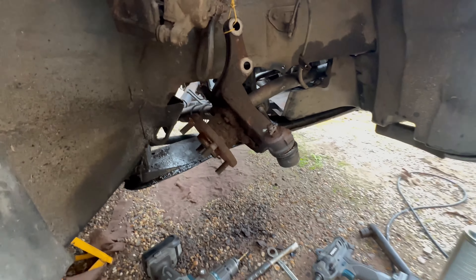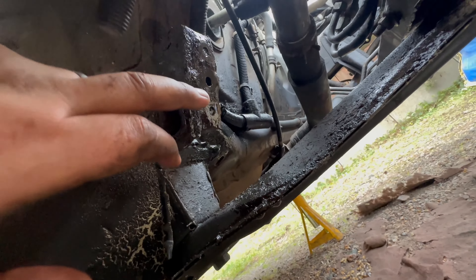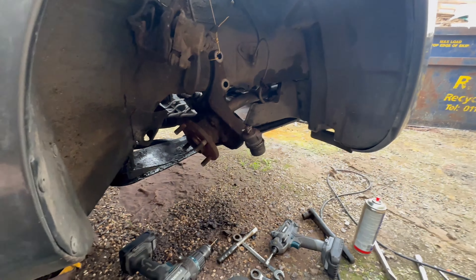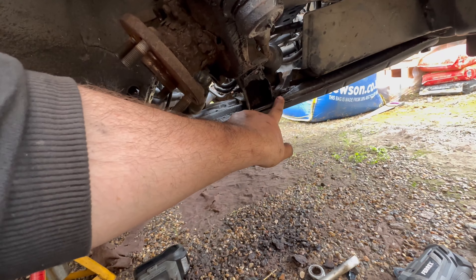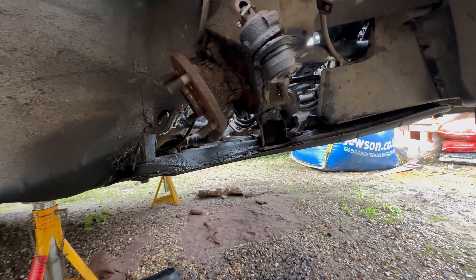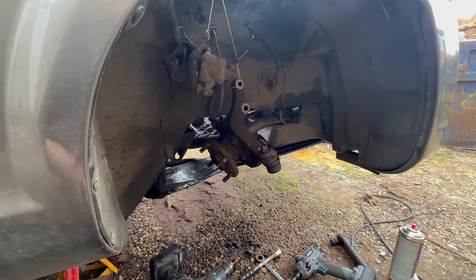I've removed the lower arm, which was not easy - I had to cut the lower ball joint and the rest is still in the back of the hub. I've got access to the mount now and I've started tapping a hole through it, but it's very tiring work. The new lower arms I've got match exactly the ones I've taken off, so I've got the right parts. However I had to cut one bolt out as it was snagging, so I need to order a new bolt. Unfortunately that means I'm not going to be taking this to Brand's Hatch this week - there's just not enough time. Tomorrow I'll just be putting new pads in the 86 and checking fluids to take that instead.